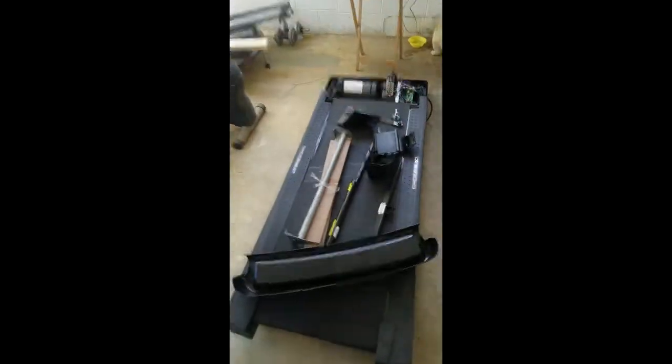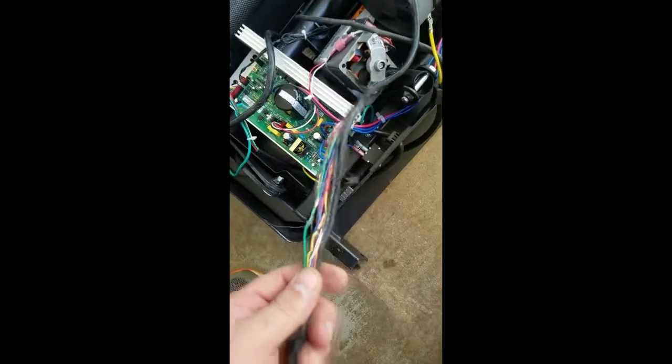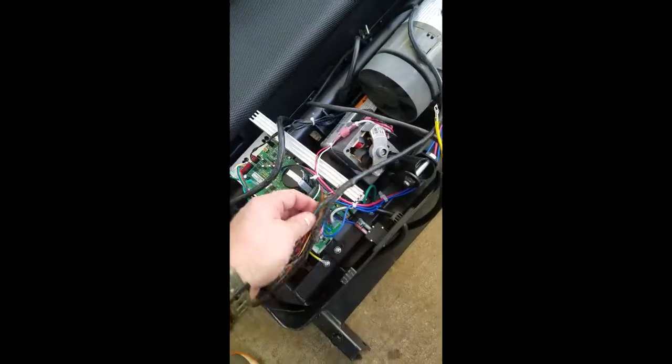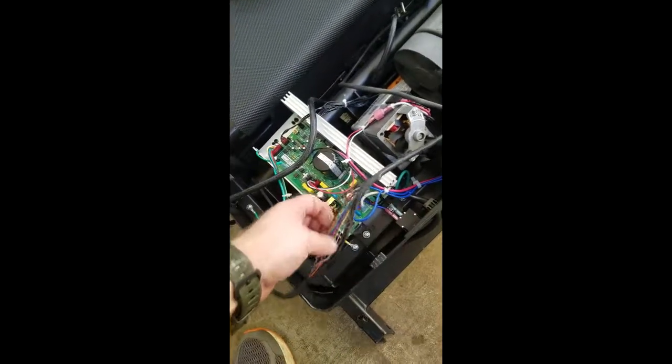It's got some broken bits and bobs, and if we look down here, we can see that what we have is a bunch of no good, rotten, stinking wires. We got frayed ends, we're gonna have shorts and intermittent contacts. Now these are all data wires for the most part. There's a little bit of power ground. But the ends are still good.